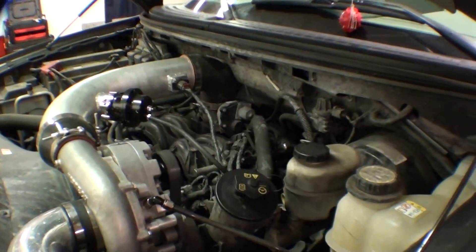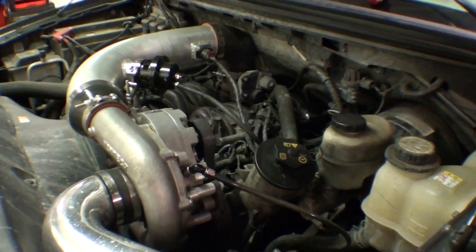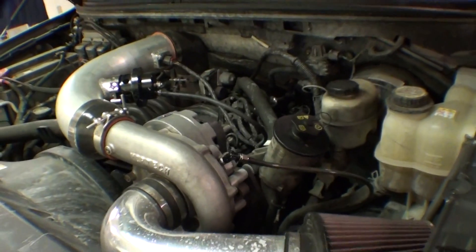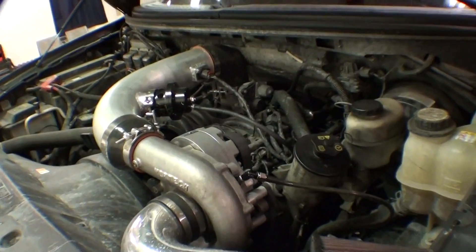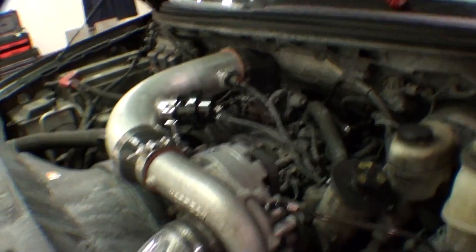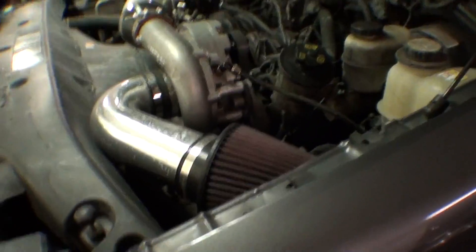Other than that, amazing part throttle power — these things are dogs stock. Most of what you hear is the electronic throttle, which is still very finicky. Very disconnected feeling — you hold it and it swings all over, which makes it a little more of a mess, since they don't have all the data logging capability yet. You can't see and modify all the numbers yet to fix them, because it sees more air. The throttle percentage is changing because of the air amount — the electronic throttle works off of the airflow over the throttle body calculation.